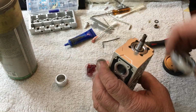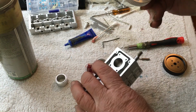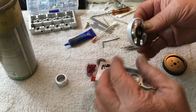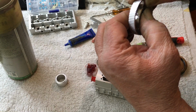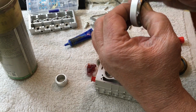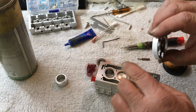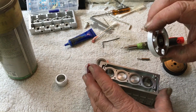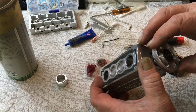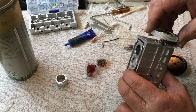Now this is very important. They say to have the brown side out. So here's what it's going to be. Motor clockwise, the starter motor is going to turn it. That's locked up, that's free. That's locked up, that's free. That turns the whole bearing, that's free. So being that it runs counterclockwise, you're going to put it on this way with the brown part of the bearing facing outward.